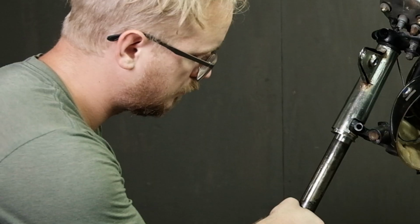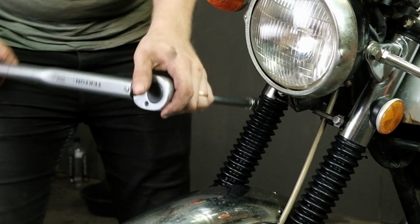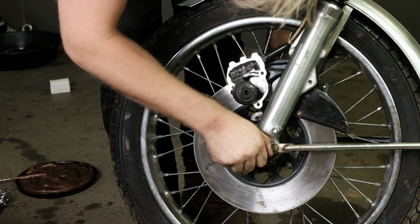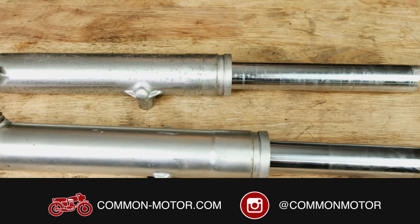When reinstalling your forks, follow the order in which you disassembled everything from the motorcycle. Once each fork is in, torque the lower triple tree bolts to the specification in the description below. Don't forget to also torque the front axle nut to the spec in the description as well. Last thing to do is go enjoy your freshly rebuilt front suspension.